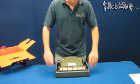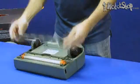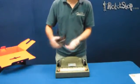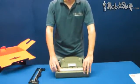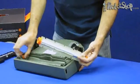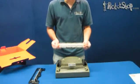The Neato uses a one-brush cleaning system. You've got two little clips — just press them forward and lift the brush guard up, and it comes right off. The brush guard has a rubbery strip that acts like a scoop when the robot's moving, helping the brush pick up debris. There's quite a large brush inside; grab the idle end, lift it up and pull it out — it's belt-driven with teeth. The brush can fit in either way, so there's no risk of putting it in backwards and damaging anything.